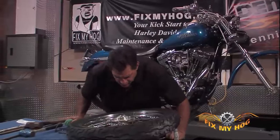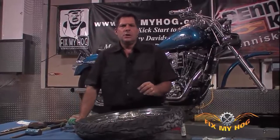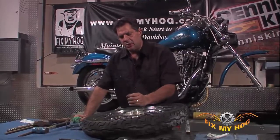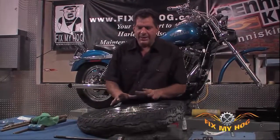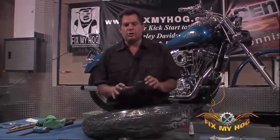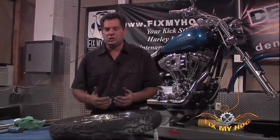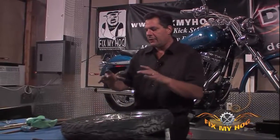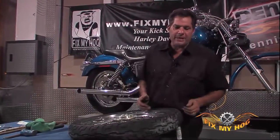I want to make sure I didn't cause any damage, whether it be marks, scratches, whether the hardened steel race bit into the aluminum and dragged some of the aluminum out when the bearing came out. You don't want any damage to the hub. This is a crucial area of the motorcycle. The wheel rotates. If you're driving 100 miles an hour, that wheel and axle is spinning at an enormous rate of speed. You don't want to compromise the integrity of the hub, the spokes, the rim, the tire, the inner spacer.